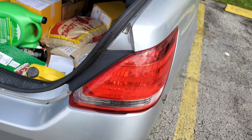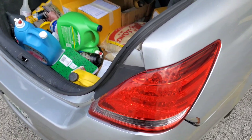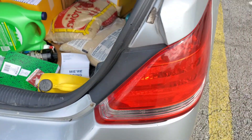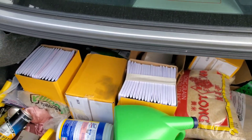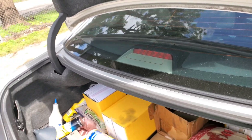It's easy — just like that. I don't have anybody to step on the brake to check, so what I'm gonna do is use these books and put them on the brake to show you guys. Right here, you can see there's no light, nothing — the bulb is not lighting up. So I'm using the books on the brake. All right guys, it took me a while, but look — bam! You can see it now, it's lighting up!